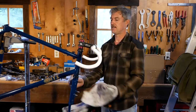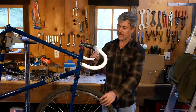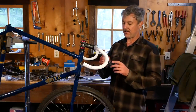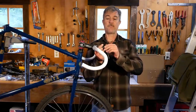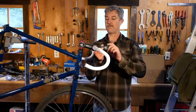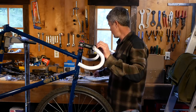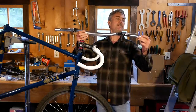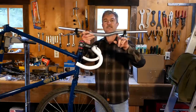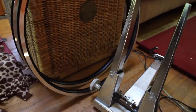So we made a little progress today. This is not the wheel I'm going to be using, but just to get an idea. I've got a couple of ideas for this bike build. I've got this drop bar on here right now just because I was curious what it would look like - I would not be using this particular drop bar. If I do a drop bar for my bike touring setup, I'll go with a wider bar with some flare. But for fun, I decided to try out this flat bar I picked up - this is a Nitto, the B8-840, so it's got about 25 to 30 millimeters of rise. We've got a set of wheels to build in order to get this ATB off the ground, so that's the next thing in the next video - stay tuned.